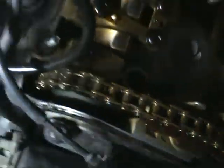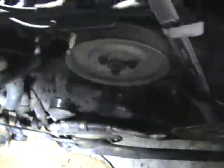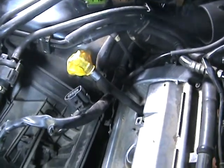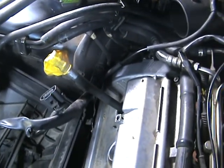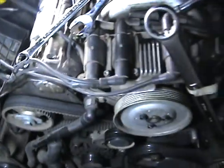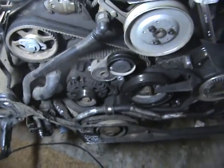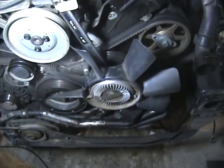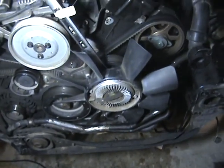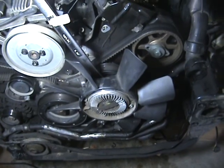So that's good to know. You do top dead center with the marking right here on the bell housing, but then also the spark plug, number three — this is on a dual overhead cam, 30 valve — so we got a lot of fun ahead of us. Gotta get to work. I'll put it back to top dead center and then I'm going to take that fan off. I'll check back in a little later — you guys know how the progress is coming along.